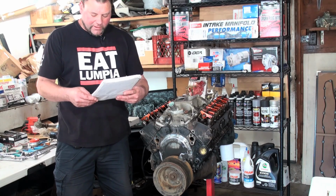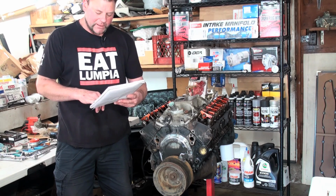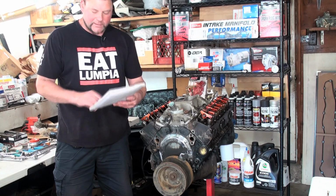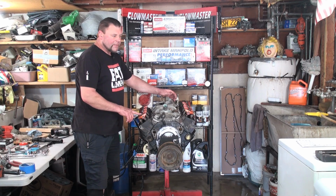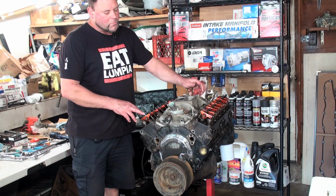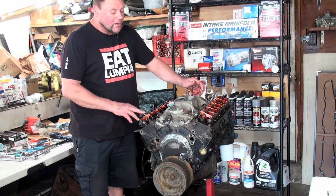So we're still all over the map with this. We're looking at anything from 135 to 150. That's 15 pounds of separation in the cylinder pressure. It's kind of all over the place, and that's not good. So we're gonna have to do some more stuff. Let me close up shop for now. I thank you for watching. Please like and subscribe, and stay tuned because there's more coming. We're gonna have to do some more tests on this to figure out if we got an issue with the rings or the valve train. Where are we losing that compression at? I don't think that it's a head gasket issue. Maybe it is. Well, we're gonna have to find out what's next.